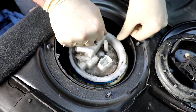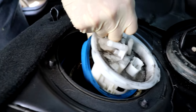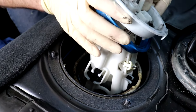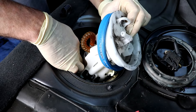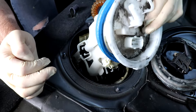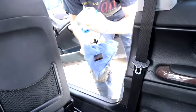They give you a little pull handle — we're gonna lift up on it. It can get stuck sometimes but it's seated in a rubber gasket, so take it out gently. There's gonna be a little hose there that we'll replace. Bring it up together and remember you have the sending unit and the pickup strainer that sometimes gets caught on the edge. Here's your sending unit for the fuel gauge — take it out of the car.